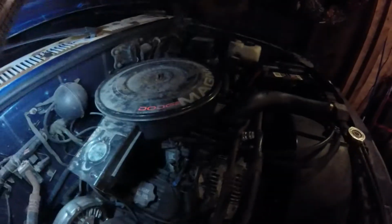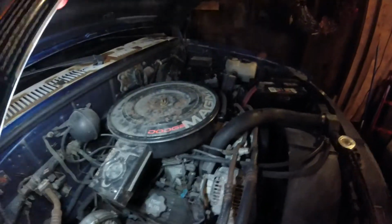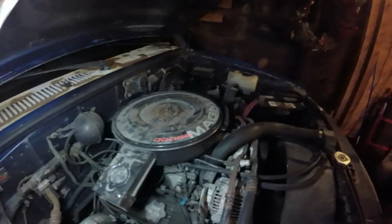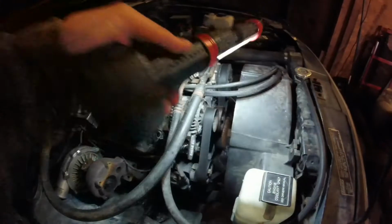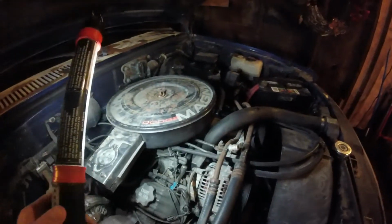Piping and everything. So of course the intercooler will be here, and then it'll just run to one of those Spectre air hat things. I'm not going to use a plastic one because I destroyed 2 of those on the green truck. I'm just going to get an aluminum Spectre air hat for like a carburetor or something. So it's going to go turbo, pipe, and then intercooler, and then over and up into the intake.